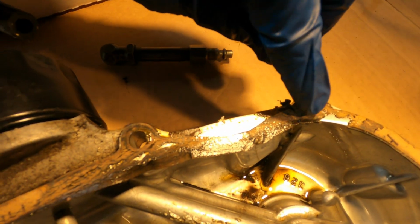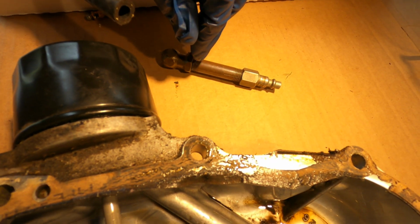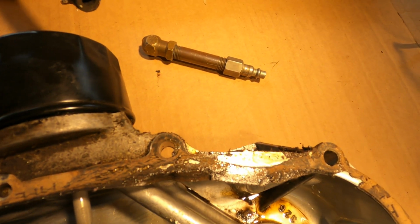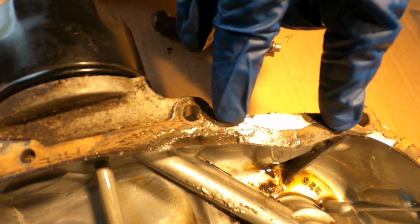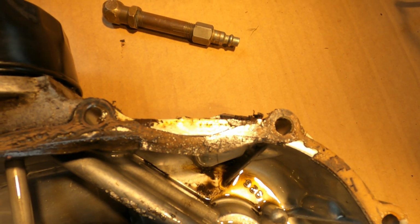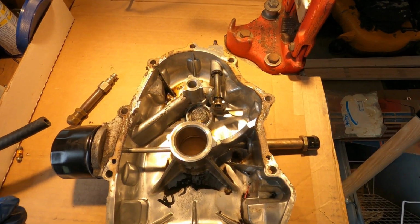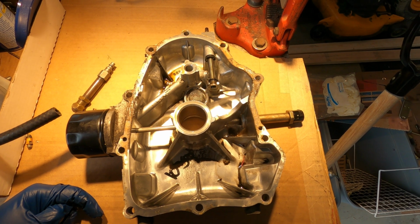Now look over here. The darkened area on the inside. You can see it was pinching down on it here and here. Like here and here, but it looks like that section of the gasket was never really even squeezed in there. I don't know if that was installed properly or if that's really how it happens, that the gasket pulls in, and see there's no marks on it as it having ever been squeezed between the two halves. So I'm not sure what happened there, but the gasket is definitely not properly aligned to where it needed to be to stop the oil from leaking out. So anyway, now I can get to work with removing the gasket from the bottom sump pan gasket sealing surfaces.